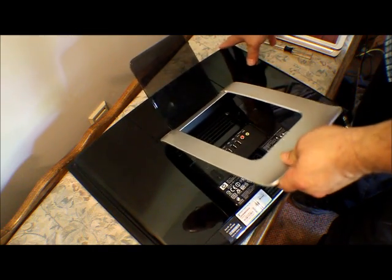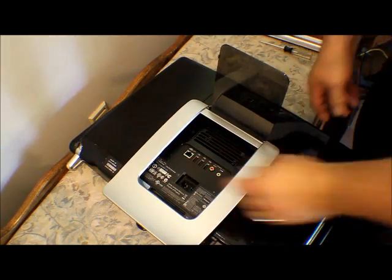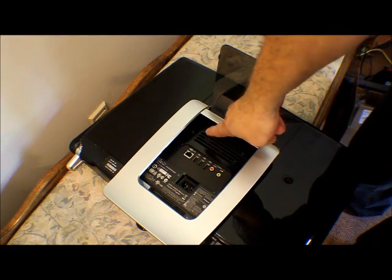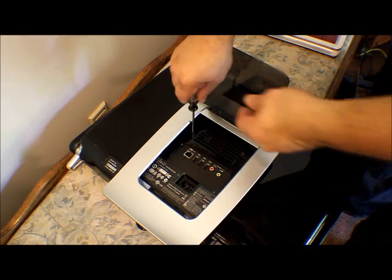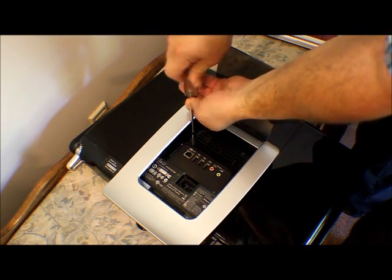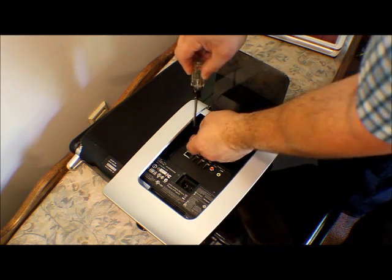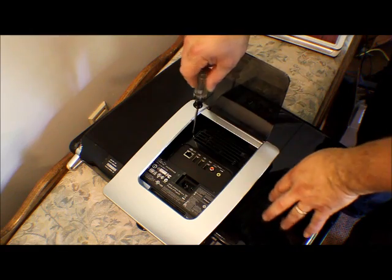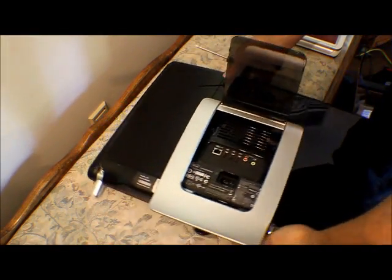In order to get to the hard drive, back here is a screw, right in there, and there's another one on this side — that screw has to come out. We're going to take the side off. This is where the CD-ROM is on this side also, so that's why I selected this side. The memory's on the other side, so you'd do the same thing on that side if you ever want to upgrade or change out the memory.